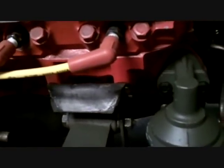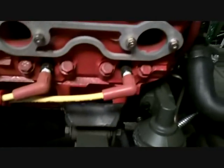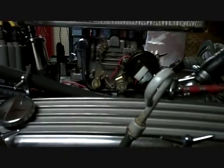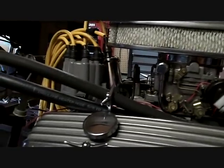I don't remember where they used to go normally — was it on the front of the engine? I have to connect the block itself to the frame as a ground because it's negative ground. My electric choke has to be connected — that goes up to the ignition. You cannot hook it to the coil. If you hook it to the coil, it will drag the coil down. The coil won't trigger happily.